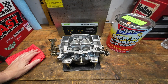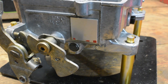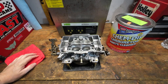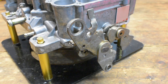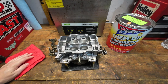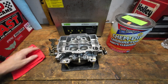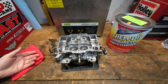If you've got any decals on here, like the Made in USA decal or the Edelbrock badging on the front, it does beat those up pretty hard. The decal they use on the side is usually pretty robust — if you use ChemDip on its own and don't let it soak in and really get a chance to break it up, it doesn't do too bad. But if you use it with heat and it's in there for 20 minutes, it completely wipes that off. So if that's important to you, that type of cleaner may not be what you're looking for.